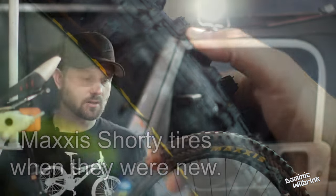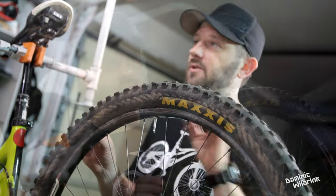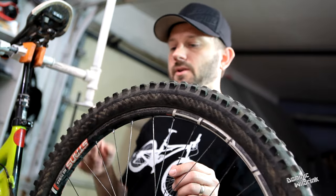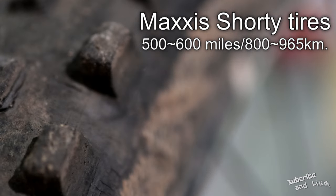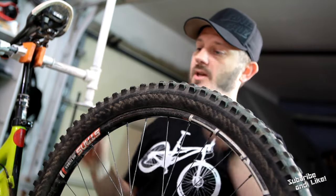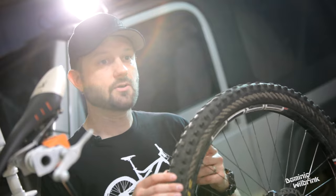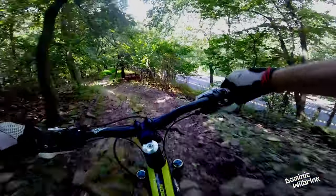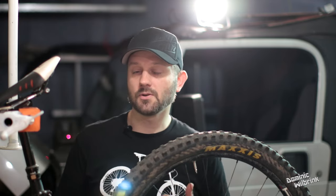Let's take a close look at the wear and tear. The rear, compared to the front, is in much rougher shape — I didn't rotate them, and my ride style is a lot heavier on the rear. The sidewalls on the back took a real beating. In the last month I actually had to put stands in, lay the bike on its side, and spin the tires to get sealant on the sidewalls because they started leaking badly. These technical east coast trails have a lot of rocks, and on climbs you slip off rocks and the sidewalls catch a lot of abrasion.